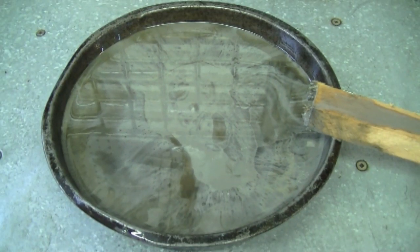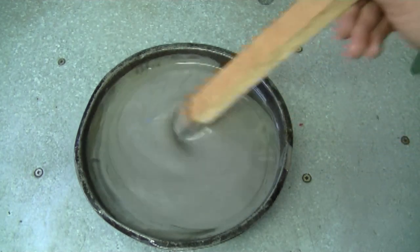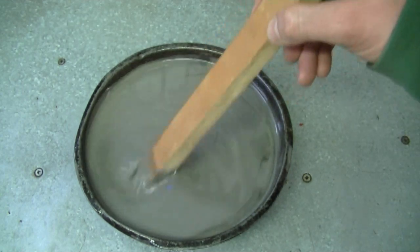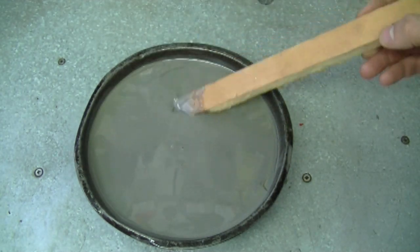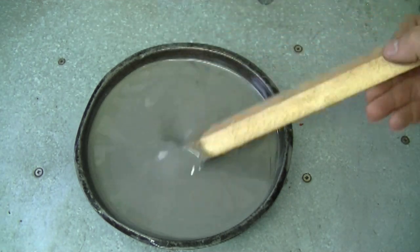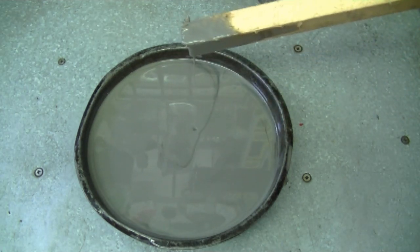So here's the oil. The oil has settled a bit but if I stir it like this you can see it turns gray. This is because there's a bit of moisture or water in the oil. And when it becomes gray like this it just doesn't have the same performance that it should or the same viscosity. Therefore your engine parts can wear prematurely and you can end up blowing the motor.